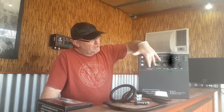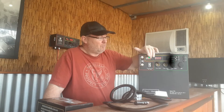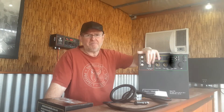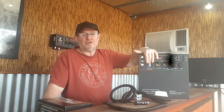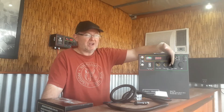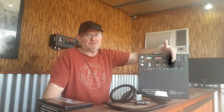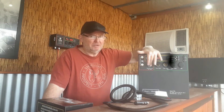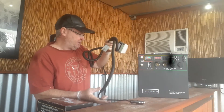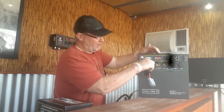We also get people trying to charge with another DC charger in their vehicle. An electrician will call saying it won't take charge, and when I ask the amperage they say 26 or 27 amp. They assume there's a buffer because the input is rated 25 amp — but the numbers and ratings are the ratings. If you don't follow them, you'll run into trouble. It's rated at 25 amp maximum input. Put in 25.5 amp and the little red light goes off, the unit won't take charge, and it goes into an overcharge protection mode. You need to draw current out to reset the switch. Maximum 25 amp regulated input, maximum 10 amp unregulated input — the unit has an MPPT controller inside.